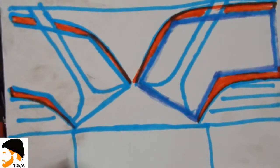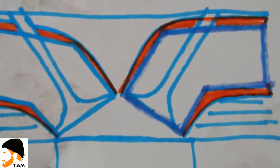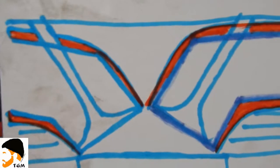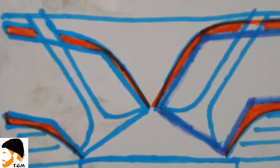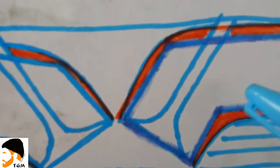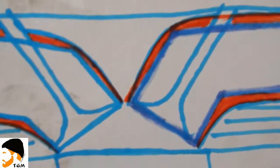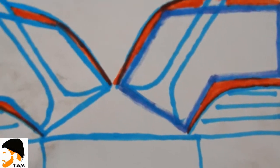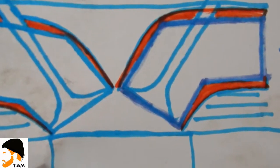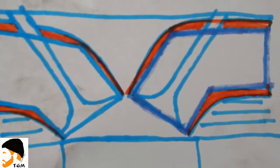Smoothing the ports allows more air and more fuel to go in at once. By increasing the port size we can use larger inlet manifolds and bigger carburettors, and on the exhaust side that allows us to increase the size of our header and overall exhaust tube diameter through the system. We want to make sure we don't take too much material out — it's quite risky around the valves, valve stems, valve seats, and the same on the exhaust side. The inlet side is done and there'll be a photo laid in after this showing the difference.